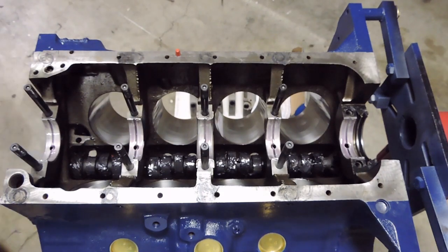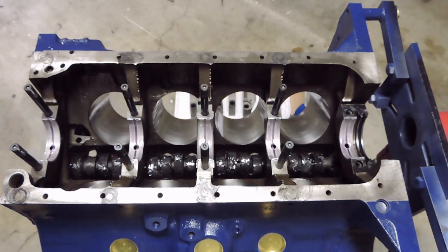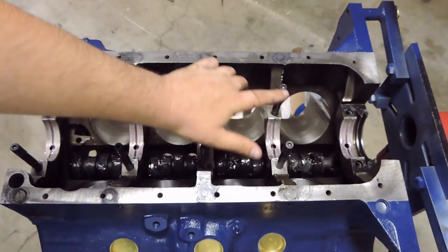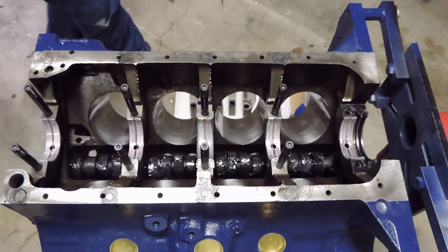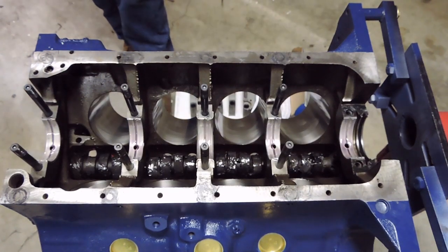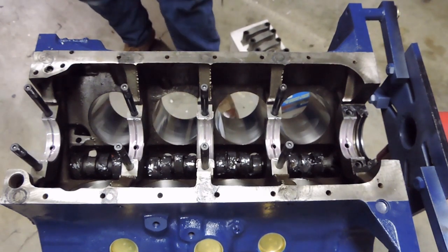Alright, it's just like that. I'm going to say that's pretty good on lubrication on there. So I am going to go ahead and grab the crankshaft here and set it in. Now, you've probably noticed by this point I do have studs sticking up. These are all ARP main studs with the engine. And the crankshaft was locally reground and polished 20 under on the rods and mains, because when I got a hold of it, it had already had a previous 10-10 grind on it.